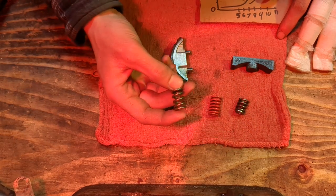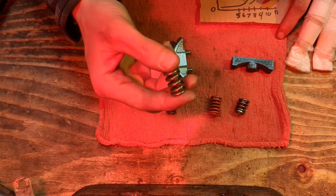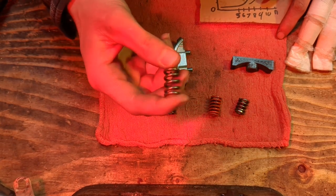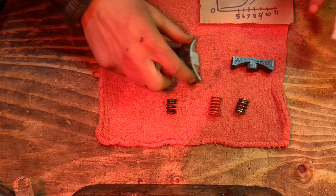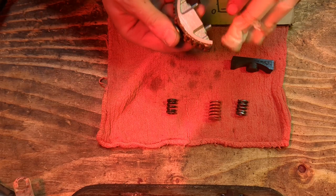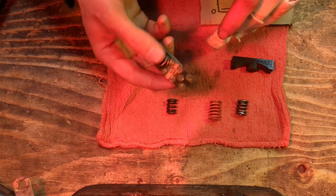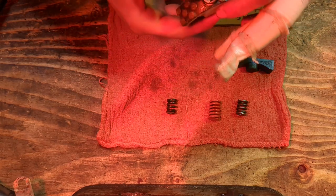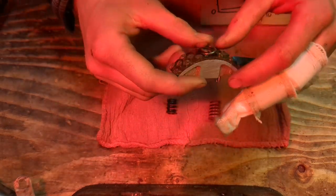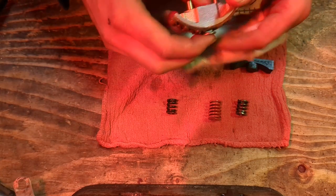One thing you can do, you could take this stiffer 22 millimeter spring and add washer stacks for a beginner rider. This is still a 15 millimeter, it fits right in. No modification required, although I'd still probably drill the hole in the side to keep it clean. This is going to take some work to actually squeeze down and get the threads to engage.